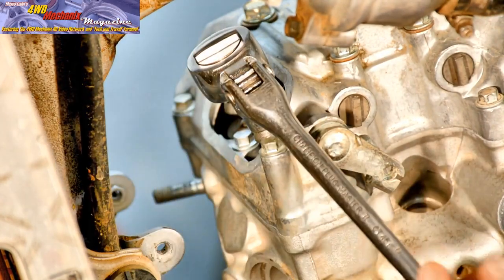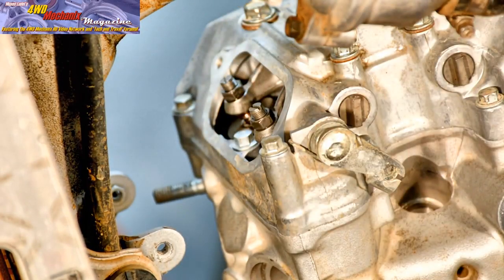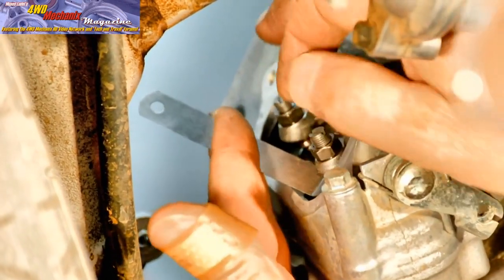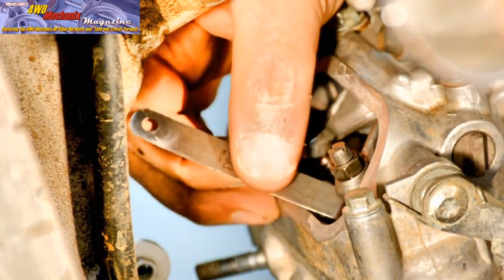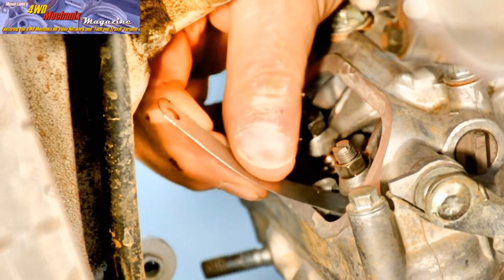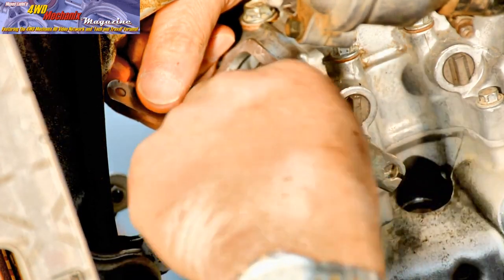Use a higher gear to move the flywheel slower. Remember to reduce the amount of tension on the rocker arms if the locknut is too tight. Use a ratchet and socket for rotational force instead of tugging hard at the rocker arm. If you need to rotate the crankshaft during a valve adjustment, make sure you maintain proper valve timing by rotating the rear tire only in a forward direction — always — to be certain that the timing chain is pulling the valve timing correctly. You want no slack in the chain while making sure that the camshaft timing is accurate for top dead center on the compression stroke.